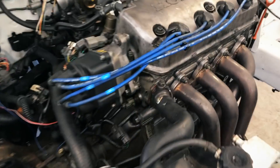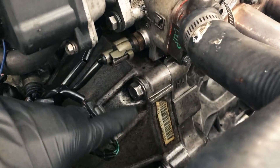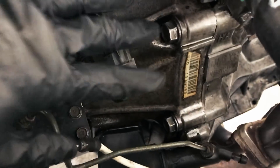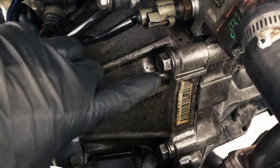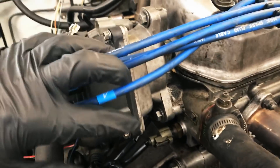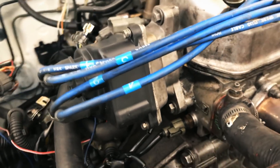There are really two main points of concern for me. One right up here — you can see some fresh oil that's built up, kind of glistening right here. So I'm going to go ahead and replace the distributor O-ring. And while I was there, I went ahead and got some VTEC gaskets.